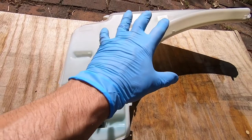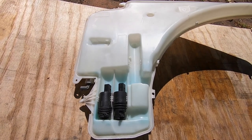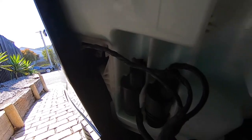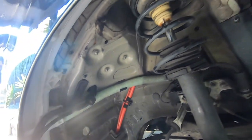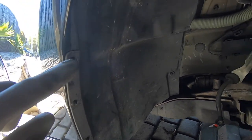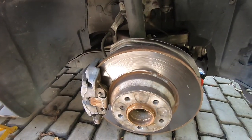Everything's all cleaned up nicely now and back together, so we're ready to reinstall it back into the car — it's literally just the reverse of removal. The three electrical connectors are fitted back on, the two hoses from the pumps reconnected, the harness clips are all back in. We feed it back into the wing, reconnect the hose, and reinstall the bolt. Now that's all back together, we refit the wheel liner — and even managed to get three proper pins for the wheel liner. Next up, refit the side indicator, then refit the wheel and drop it back down.